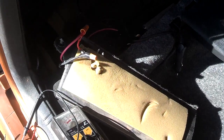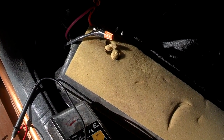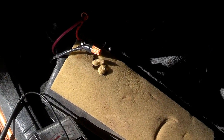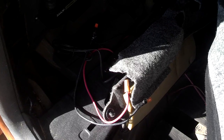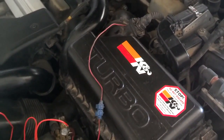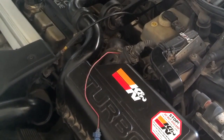I'm not getting any 12 volt reading from any of these wires, so I'm going to track them to see where they're going. All of these wires and connections back here to this outlet are dead — kind of like a bridge to nowhere — so I'm going to find a wire and run it back here to get this rolling. I see an orphan wire in the engine compartment, so I'm going to see where that goes and maybe use it if it runs back toward the rear of the car.